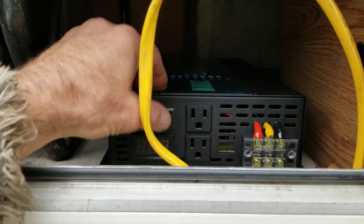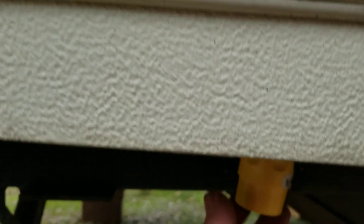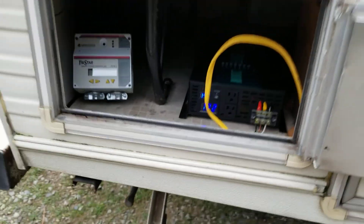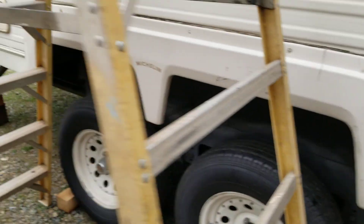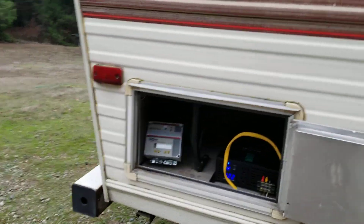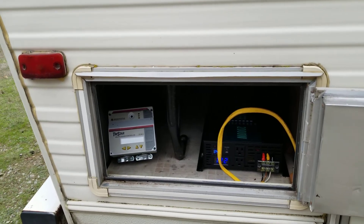There's the inverter — powers up right there. I've got this extension cord right here and all I'm going to do is plug the trailer into itself. I already tested it. When you plug into shore power, I'm just going to plug that right into the inverter and then unplug the onboard Inteli-charger so it's not a continuous loop, and that fires up the whole trailer with no problem.